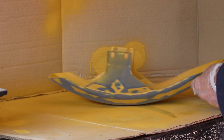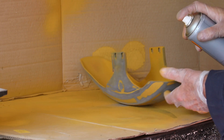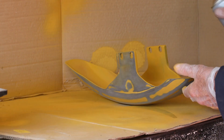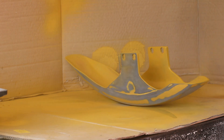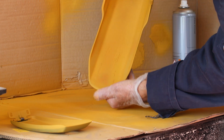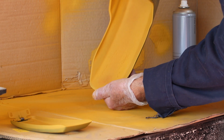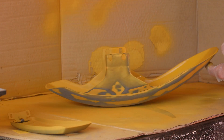Before painting the top, I did put a good couple of thick coats of primer on the bottom. I wasn't looking for a good finish here — I just wanted to cover up all of the old red paint and give a key for the top coat. I did notice some reaction between the primer and the previous red paint, but given its location I decided to press on. And here I am applying a second coat; as we can see I am putting this on quite thick.